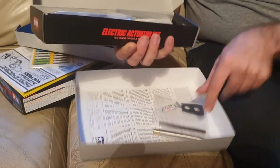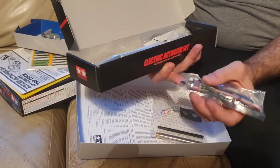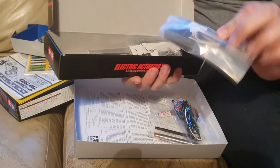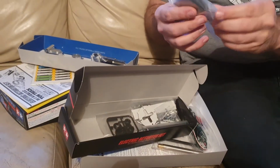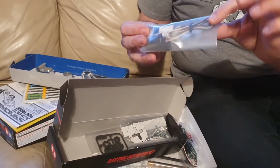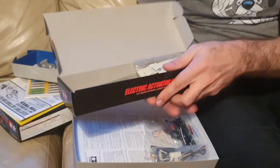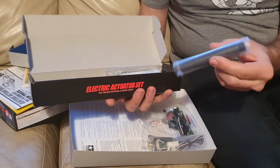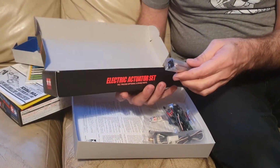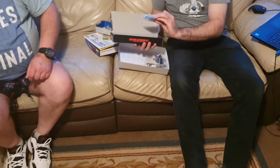Motor mounting, some grease, limit switches, a manual override switch there, power takeoff, and that's the main control box, which you can't really see particularly well, but basically everything plugs into that. That plugs into a channel either on your receiver or on your MFC, and allows you to raise and lower the entire wheel lift from the radio control, which is good. Cool. And then various bits and pieces, cable clips, that kind of idea.